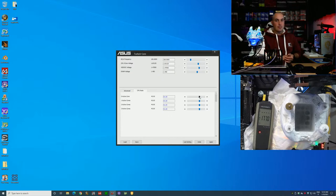It's good if you can tune the memory a bit, since 2666 is a bit slow. Depends what you gain, but if you want a bit more juice out of that CPU, take the memory at least to 3200 MHz, even if it's low on the primary timings. Manually tune the memory, 3200 MHz.